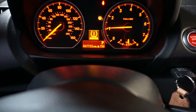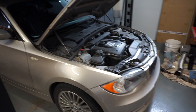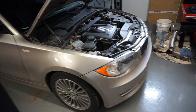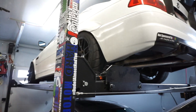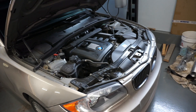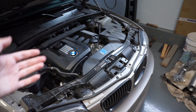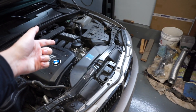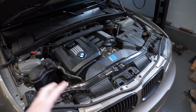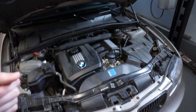So there we are at 67,732 — that puts this car at just around 750 miles. Now before we take a look at this I do want to mention one more time that I did see Royal Purple differences in my race car after 500 miles, so this has 750 miles. The biggest difference is this engine wasn't nearly as dirty as the heads I put onto that car during that testing. The oil filter will probably be our biggest sign — if the bottom of the engine was really dirty, a lot of that crud will get stuck in the filter. This is our 750-mile check-in, and I'll probably do another one closer to 1,500 miles.